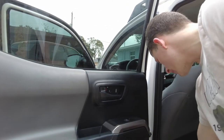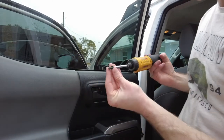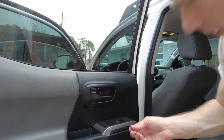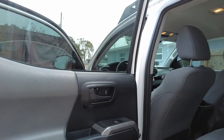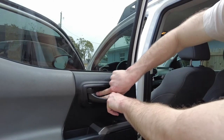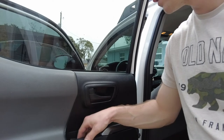Lastly, we have our two screws. I have them placed on my floor mat — the lower one goes to the lower screw, which makes it easy to remember. It's also the real fat guy that goes into your door handle. Tighten that back up. Your smaller thin guy lines up here and holds your handle. I can hear the gear opening — that looks like it's still connected; this would just be very loose if it wasn't. Go ahead and put your nice door panel cover in there — open this up all the way, just push in right here, and you can hear it lock in. There's a little spot where it clips in. Put your little piece of carpet back in here and you're officially done.